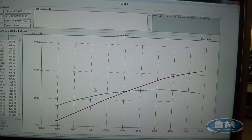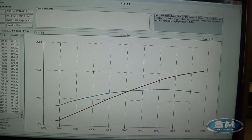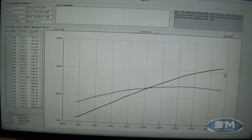Here is that pull right there. It just went up to 7,100 RPM. The pull before this actually laid over right at about 7,000 RPM. This one is still climbing a little bit, but torque rolled over around 6,100, which usually means horsepower ends up rolling over right around that range too. Good smooth graph, good broad flat torque curve.